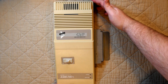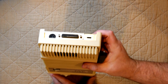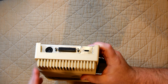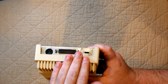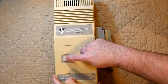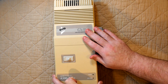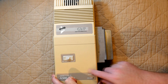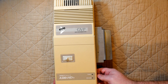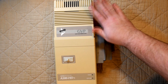I filmed the hardware section separately to the install so we won't break anything. Around the back is the power connector as well as a 25-pin SCSI connector. From the docs it seems you could actually daisy-chain 7 drives to the machine. On the top we find the switch that selects between auto-boot and game mode. Most of the time you can leave it on auto-boot, as you can still start software from the floppy drive if it's inserted before starting the computer. But some games can get a little weird with the drive and its firmware, so you can turn it off with game mode to allow those games to work, as it effectively turns the drive off while still allowing you to leave it connected.